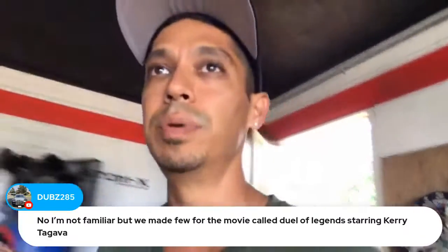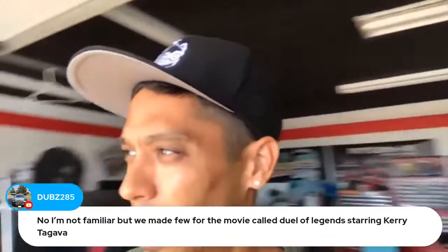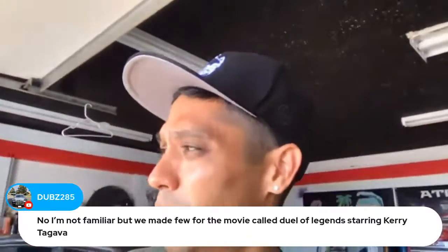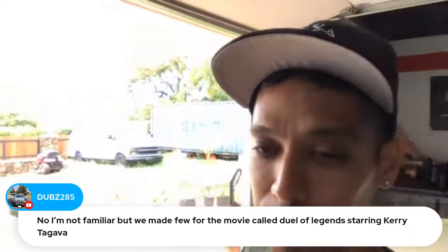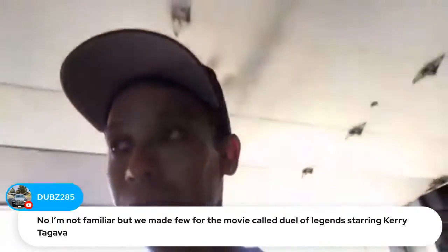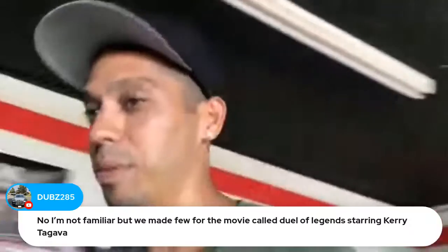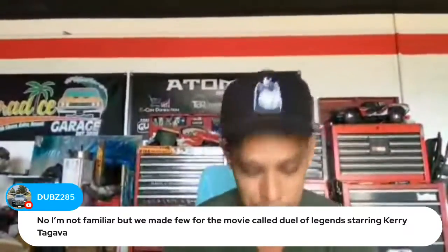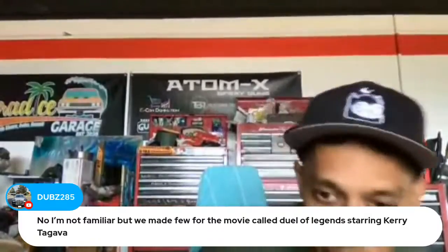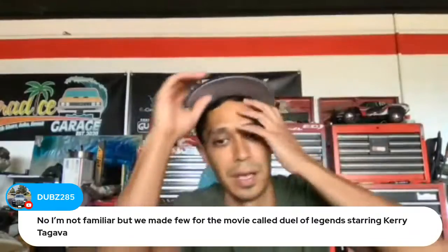The next video is going to be painting the actual van. It's not running right now. The fuel pump went out on it, so I just ordered another fuel pump. Hopefully, I get that thing back on the road because I need it. And it sucks because I just replaced the fuel pump on it last year, and now I feel like it's the fuel pump again because it starts, but then it just dies out. It feels like it's starving for gas.